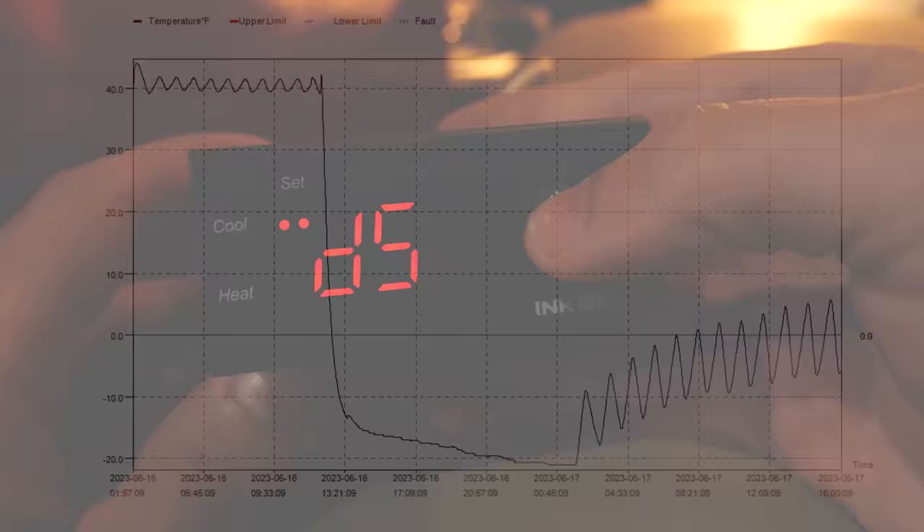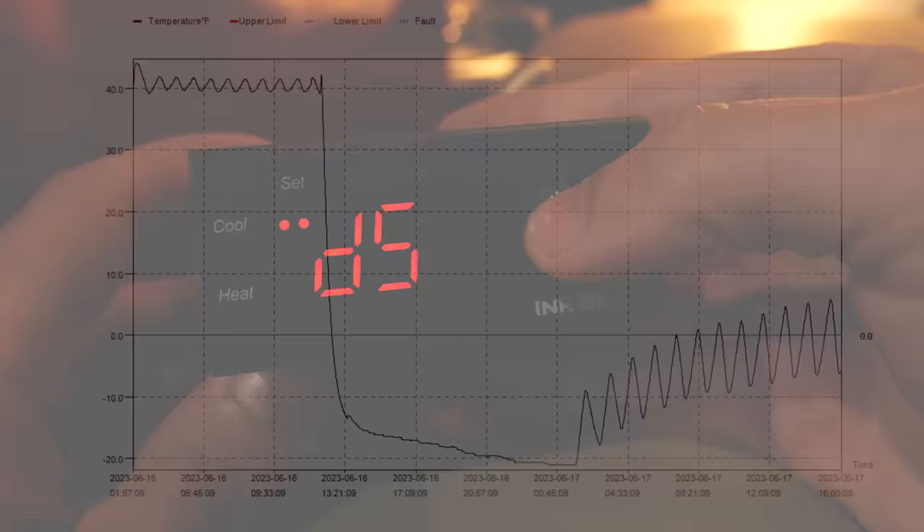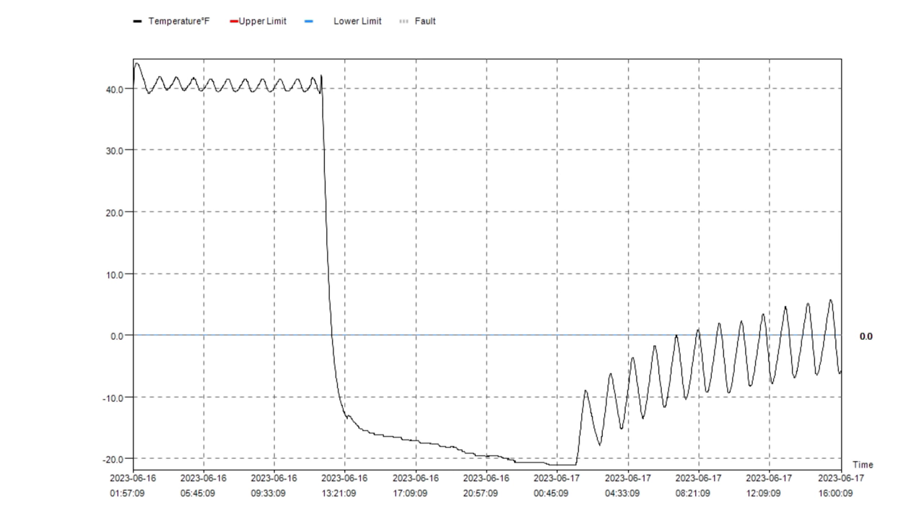And the freezer! Earlier I mentioned that we'd need fairly long cycle times for it to work properly. Well, the three-degree temperature differential appears to be just fine, hovering right around zero degrees — at least with the probe where it is now. I started this test with all five probes in the fridge, I think I had one in the top door shelf, then remembered I wanted a probe in the freezer — so ignore the front bit. And after 14 hours of running continuously, the freezer actually made it down to minus 21°F. Good for it!